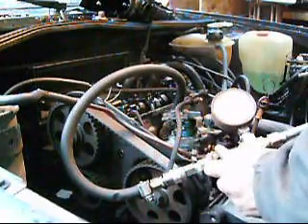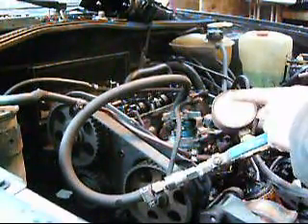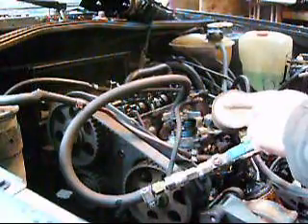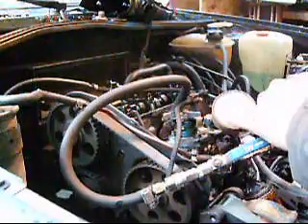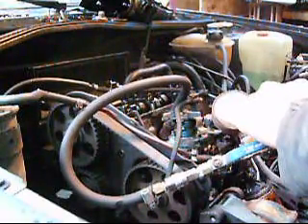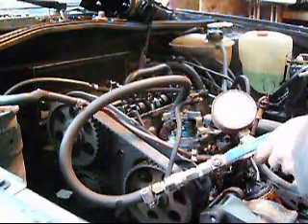We're just going to turn this on and slowly build up the pressure. We can hear air pressure going out, and we can see the gauge has gone from 100 to about — the scale isn't very clear here — 75 would be the next tick mark, so it would be about 80 to 95. So that's dropped about 15% on that one cylinder.